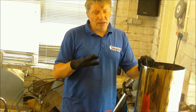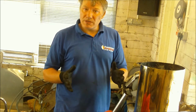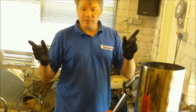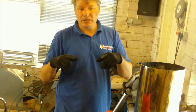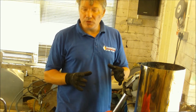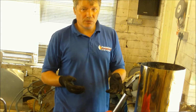Close on the sound. I know it's a cross-plane, flat-plane crank scenario, but I want to try and get away from the American muscle car sound. So what I did was I made up 2 bits of pipe, and that's now got a crossover in it. That's way too loud. I'm going to probably add a couple of little mufflers onto that one, and this will be sort of Mark II version of the exhaust sound.